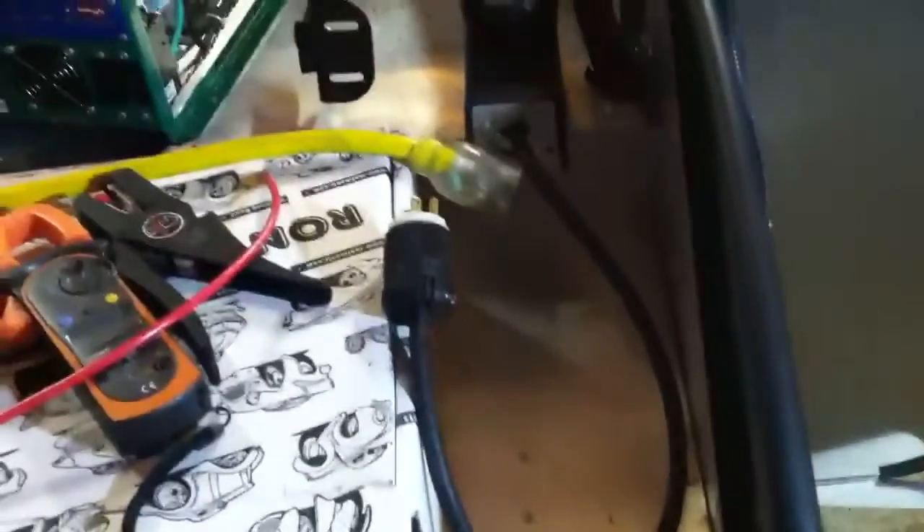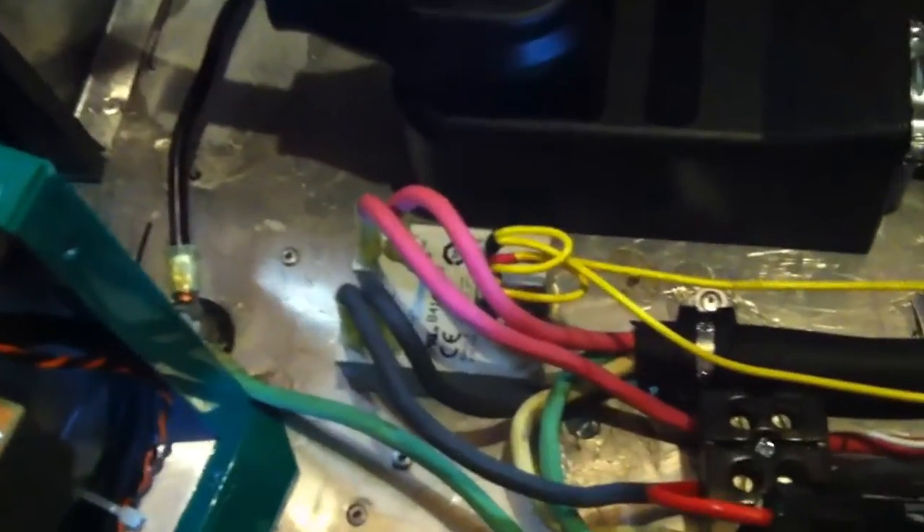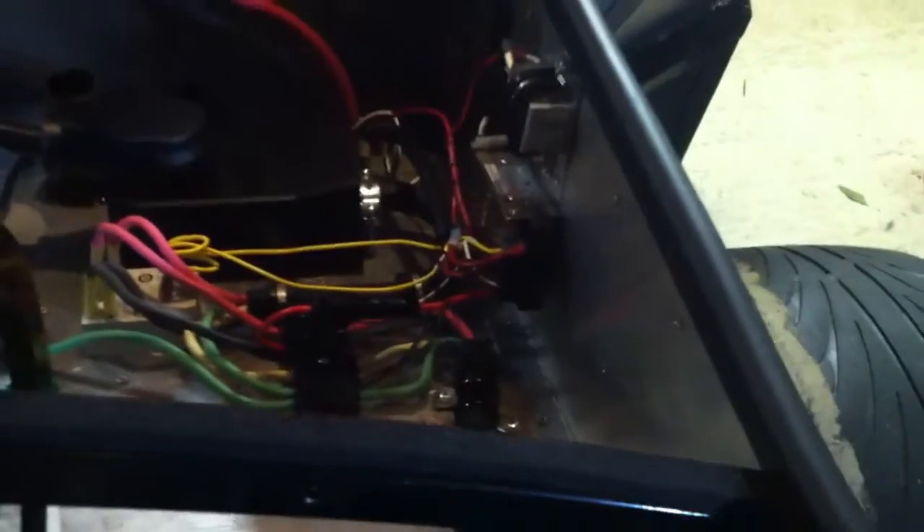The back end has now been wired for AC and DC — high voltage AC. You can see just a 110 volt input right there. It goes to a little junction box, and then into some internal circuitry here. There's a relay to control AC power on and off, another little power supply, and another relay to sense when the car's plugged in, so the BMS can make decisions about what to do.